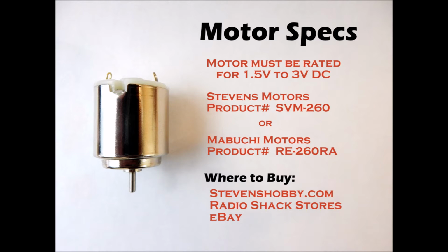That should help you locate them online. You can find them at stevenshobby.com. I've actually found this particular motor at Radio Shack stores. And of course, there's always trusty old eBay. On the far left there, you'll see the length of the motor. It's 38 millimeters, so 1.5 inches long. That's measured from the tip of the motor shaft to the back of the white plastic, not the contacts for the positive and negative wires, but the actual plastic cap on the back. And you can look at the packaging. There are schematics online, if you Google it, that show even more dimensions of the motor. So let's get started replacing it.